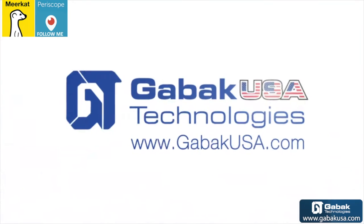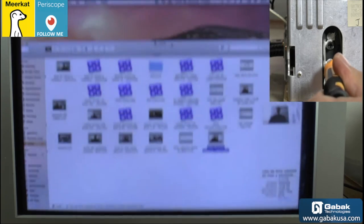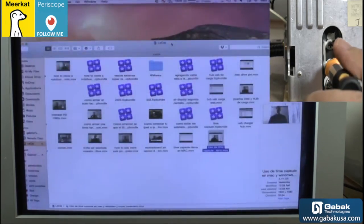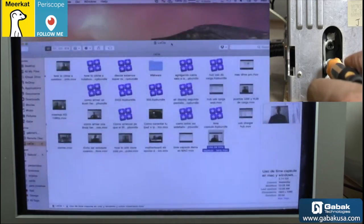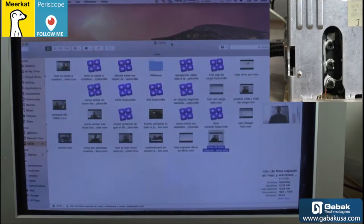Once we have the monitor that is on, as you can see here, we have to see the preset — the one that says 'focus' and the other one that says 'screen.' If you have a monitor that is out of focus, the only thing you have to do is move the preset from one side to the other until you see that it looks fine and is in good shape. Once you see that you like what you have done, leave it like that. If you move it more from one side to the other, you will see that it will get out of range and the image will not look that good — so once you have a nice image, just leave it like that.